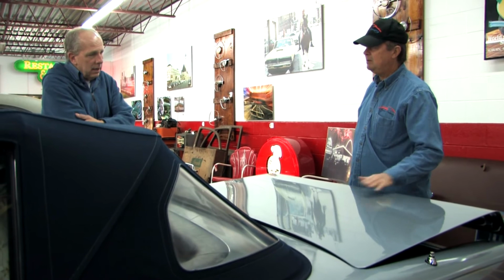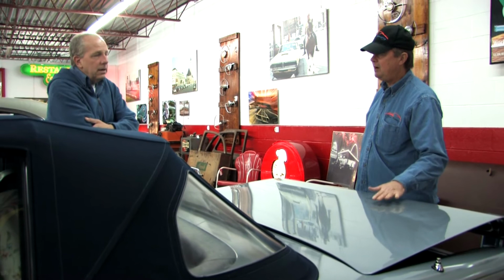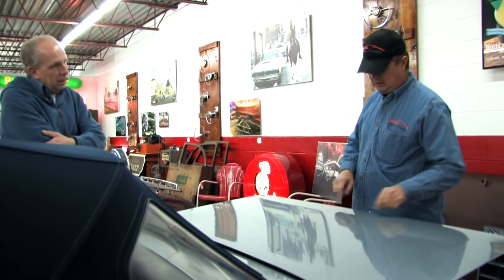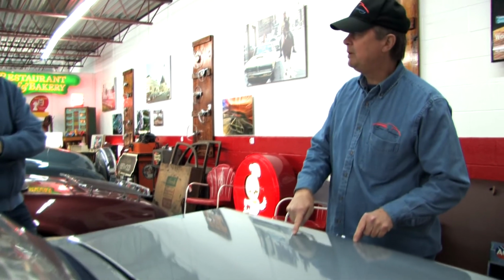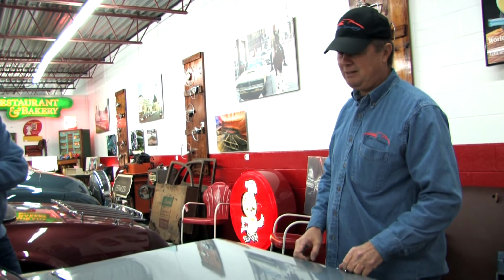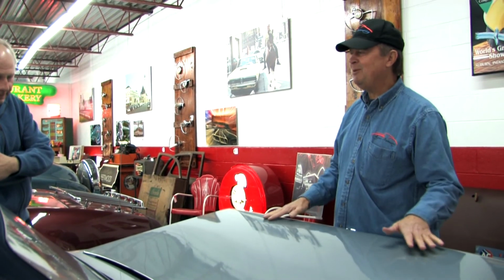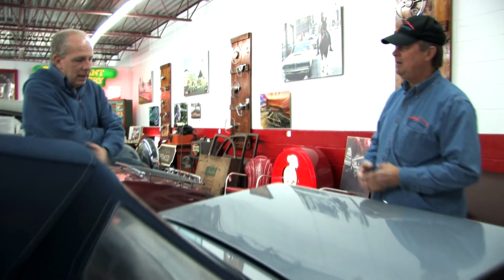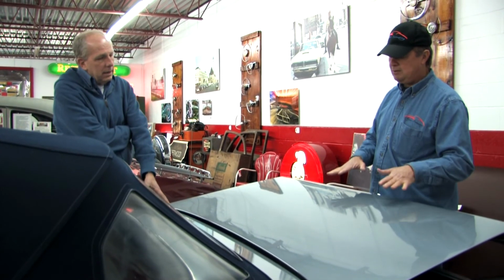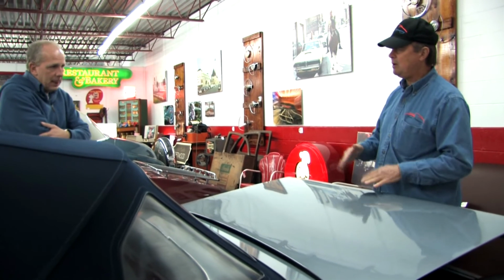So if we took it down and sanded it and then gave it a buff to see how much we got out, if it's starting to improve, we could try it again and watch real close while we're sanding. Sometimes you can see when a ring like this would start showing up. That's the danger. Once you've gone through, you're done. So you'd have to make the decision, like, we're going to paint the whole thing, but if we can not do it, we'd try it once and see if we can make this live. If we get it down so far, we might decide not to try anymore and make a judgment call.